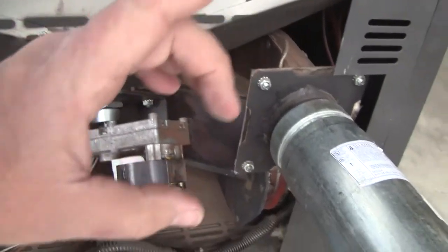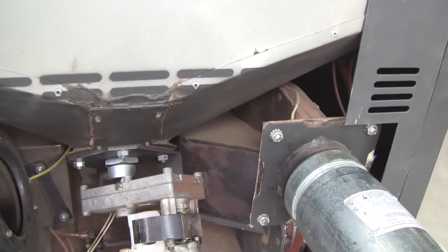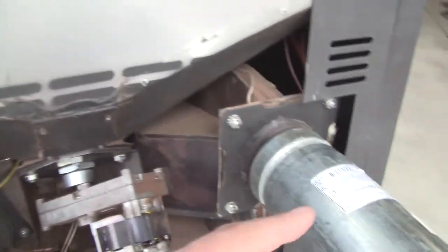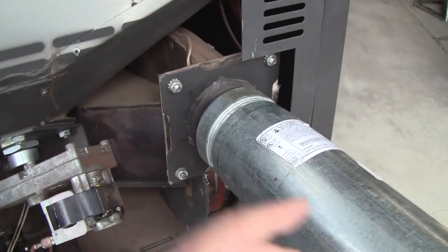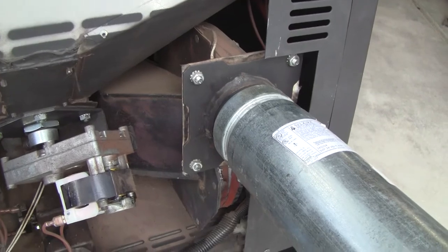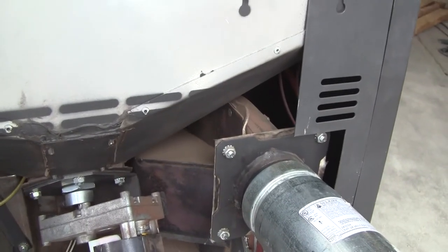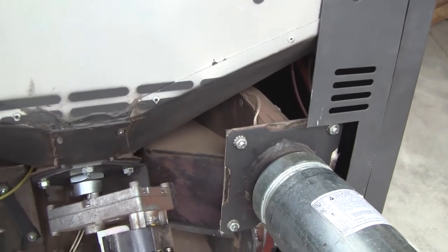There's a pressure switch in here — it's round, and you can't see it unless you open the sides. The pressure switch was bypassed. Somebody pulled the connectors off and attached them to each other, so that if there was back pressure inside the exhaust — like a plug or something — it would shut off the feed of pellets, which eventually shuts the whole thing down. I checked it with a meter and it was normally closed. You blow in it very gently and it opens the circuit; you let go and it closes again.